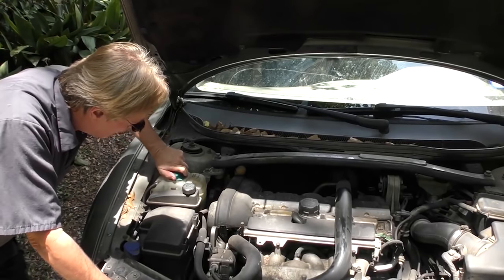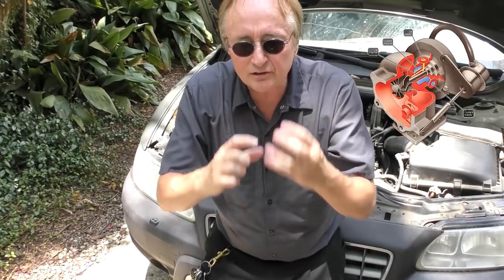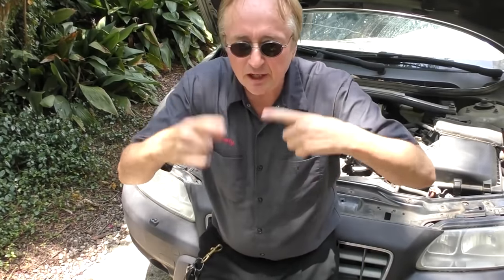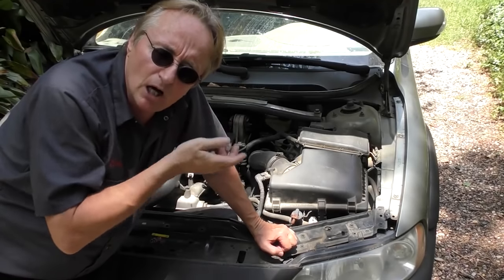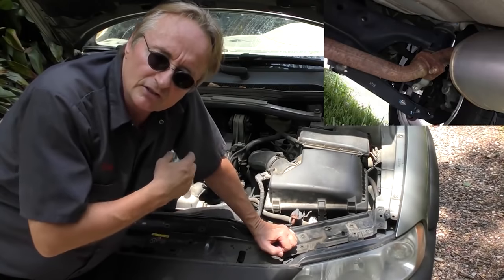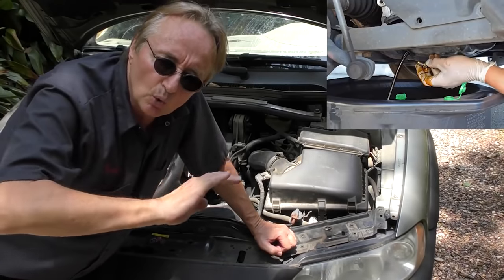Since many modern turbochargers are also water cooled, make sure you have clean coolant. These turbochargers spin at thousands and thousands of RPMs. Water-cooled units have water seals and oil-lubricated units have oil seals. If you have dirty coolant or dirty engine oil, dirt causes friction and will eat up those seals. Replacing a turbocharger can cost thousands of dollars and is a royal pain because they're bolted onto the exhaust system. All that heat means the metal is practically welded on and rusted, so when you take it apart pieces often break, requiring additional exhaust parts. Keep the coolant and oil clean to make the system last as long as possible.